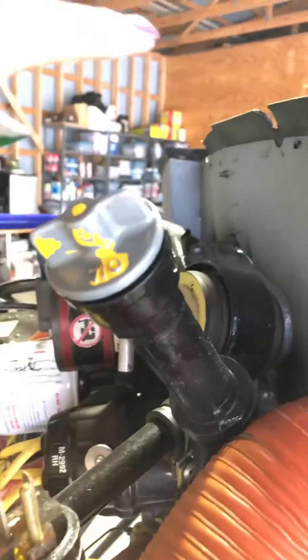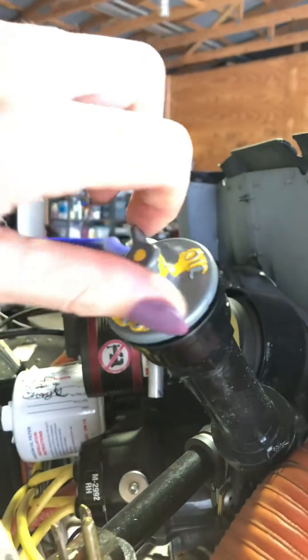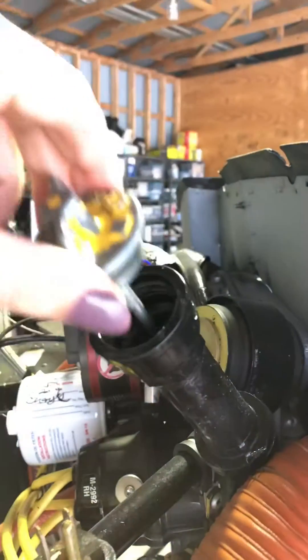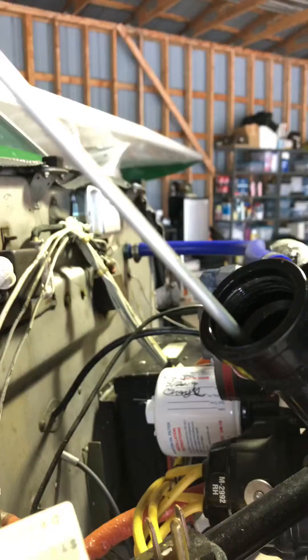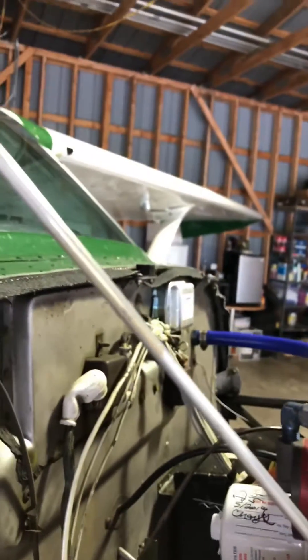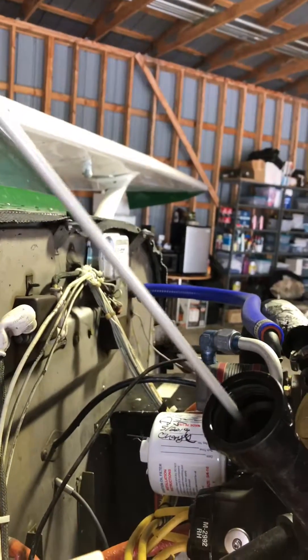I just want to give you a quick demo while I've got this opened up. To loosen the dipstick and check the oil, we're just going counterclockwise, and then we're going to lift it up. We'd read what we have on here quart-wise. In the 172, we want eight quarts for maximum, six for minimum. I'm actually draining the oil now, so that's why there's no oil on the stick.